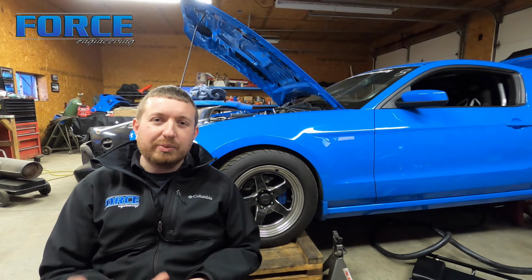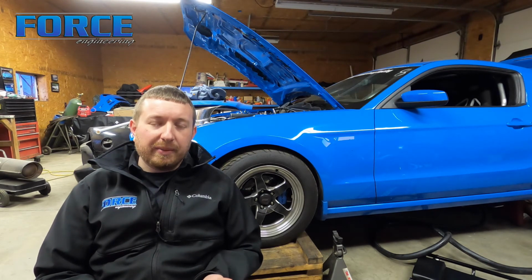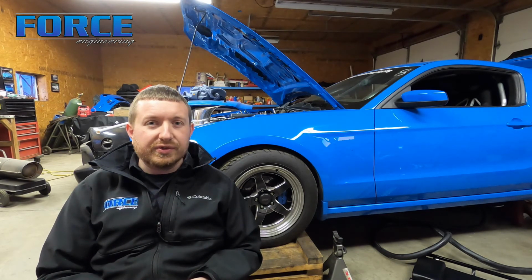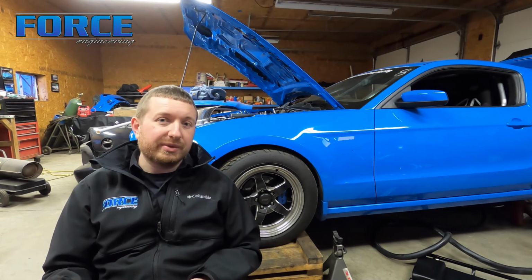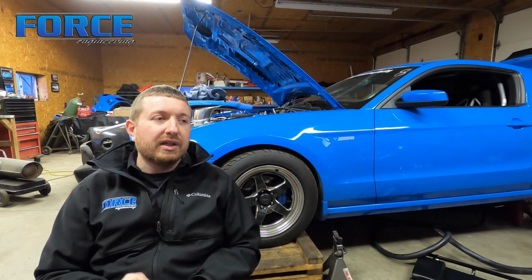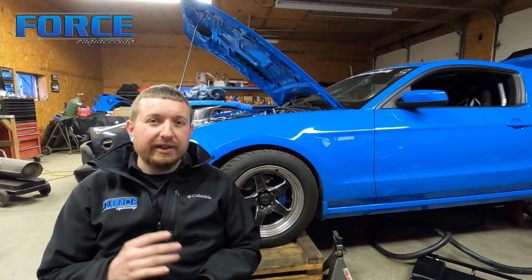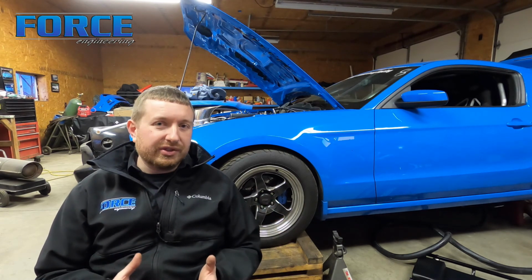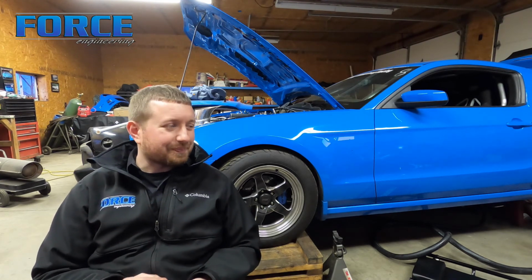Liking the idea of putting a Haltech in it. The biggest advantage I have with the Haltech in the car really is being able to do power management stuff. On the stock ECU, I'm relatively limited, whereas with the Haltech, I could do different launch control strategies so we can build more boost on the hit. If the converter doesn't allow the thing to spin loose enough to make the boost, without some sort of quote unquote anti-lag, just a launch control where we're pulling timing and adding fuel to spool the charger, I could do all that in Haltech. I could have a timing retard off the trans brake release. I can have a race timer, and all of the controls for the transmission, the boost control, everything's all in one unit, which is so nice. So I really do want to put the Haltech in it. I'm probably just gonna have to pull the trigger and do it.